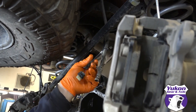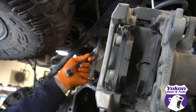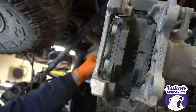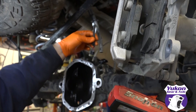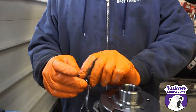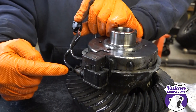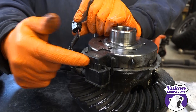What I chose to do with my locker is Mopar sells this wiring harness that has the same plug as your JL and your Gladiator. It's basically a two-wire plug with a 20-foot wiring harness — we can put the part number in the description. I disconnected the factory locker, added this plug in, and ran that straight to my S-Pod Bantam X. Essentially, I have bypassed this sensor and am only using these two wires which activate the locker.